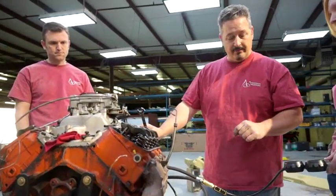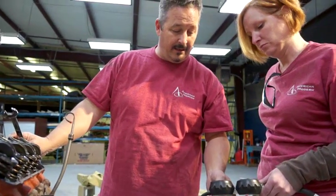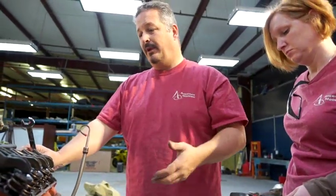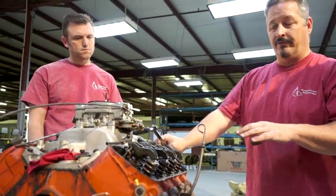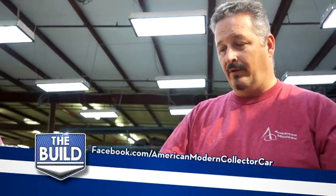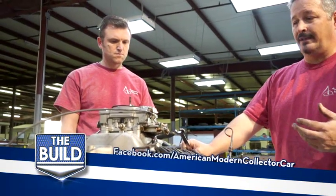We've done the first two cylinders. The leak-down is moderate at best — it's right around 30% when we first plug it in. You really want it to be like 15%, and we're at around 25 to 30. So it means it's got some wear or it's got some kind of issue. It sounds like it's going down into the block itself, which means it could need a new set of rings or it needs honing. We don't know yet, but we do know we're going to have an issue to deal with. So we'll end up checking the rest of them, see where we're at, and then assess what we need to do.